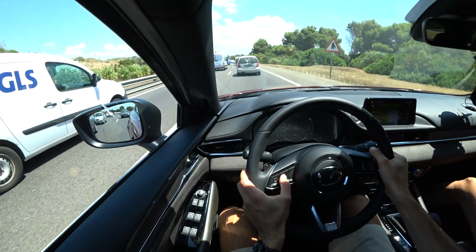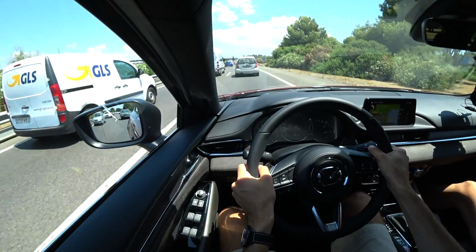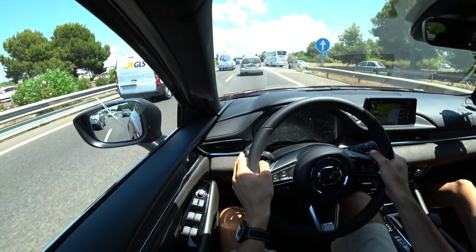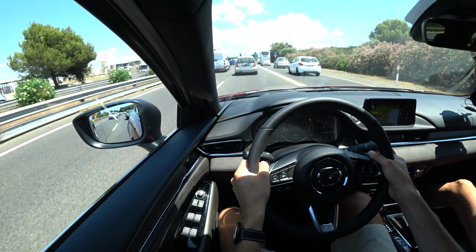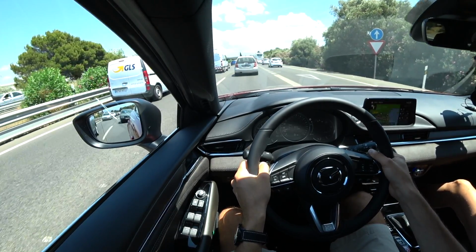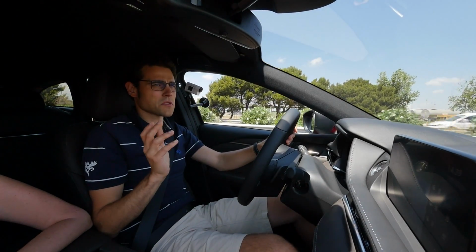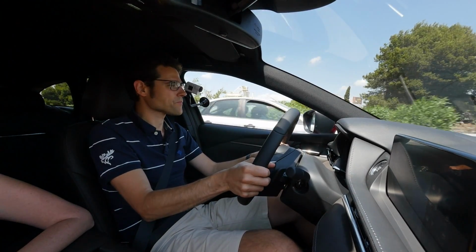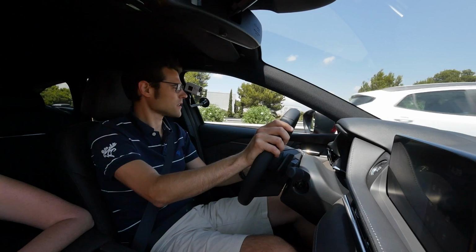That's really pretty cool. I'll also zero the consumption here, because we had one faster acceleration in there, which would not be very representative. So we'll roll a little bit slower, keep it a little bit more steady, and then see later how that affected the consumption, what we can score as a minimum figure. Usually, my experience here would be something between 6 and 8 liters per 100 kilometers. That's in the MPG range something like 30-something MPG, so 36, 30, 39, 35, depending really on the road profile. But usually they score quite good, and also more realistic than the official figure that is given.